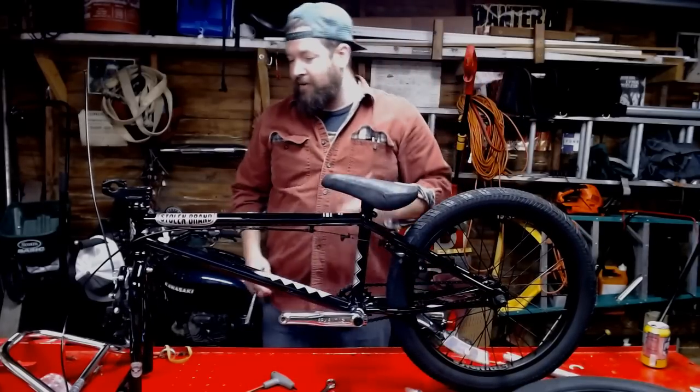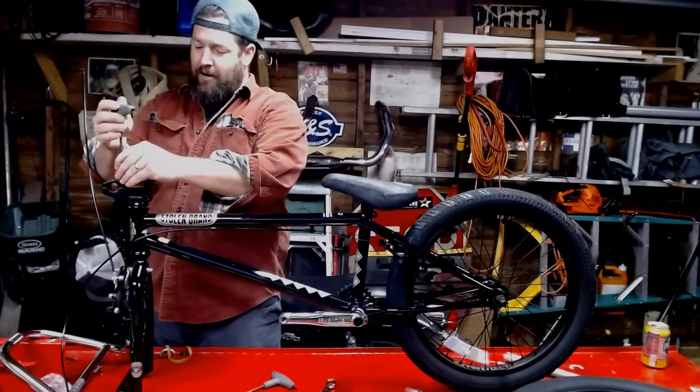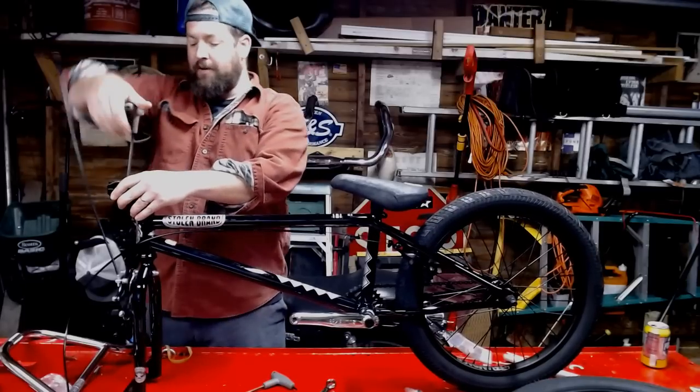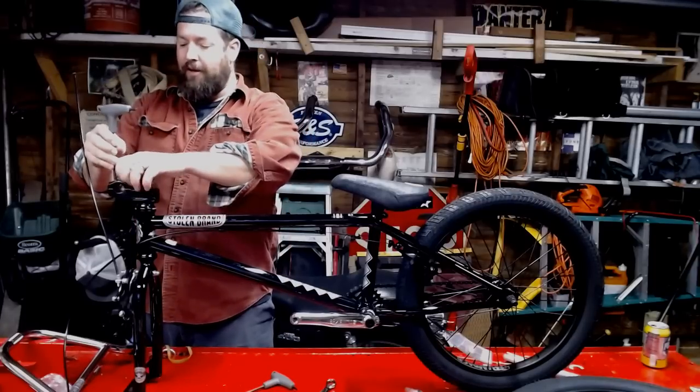This is just your seat — you ain't going to kill it, just do it good and tight. Make sure your seat doesn't move around. It sure has a torque spec to it, whatever. From there, like I said, everything is sitting on the front fork here, so from there we are going to take the top clamp off the stem, also with a six millimeter Allen wrench.